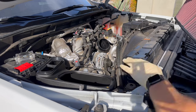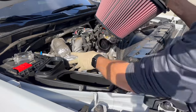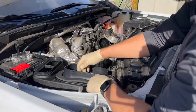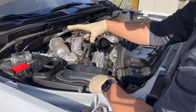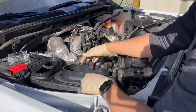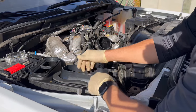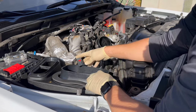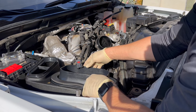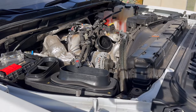We got the box in and bolted up. Make sure each of those bottom grommets don't fall off — put them into the tray first. Next we just slide this filter in, and it's a really cool design. The lid just sits on and seals here, which creates the suction. I really like that it makes it easier to pop the four 10mm bolts off and just pull your air filter out to clean and oil it. They have a recommended interval — I always like to check it every oil change. Let's get this lid on and bolt it up to the intake.